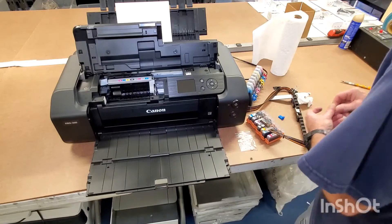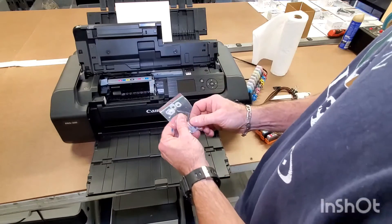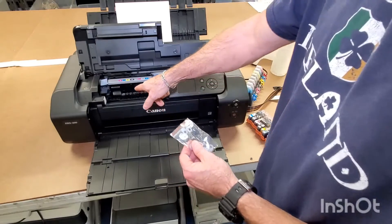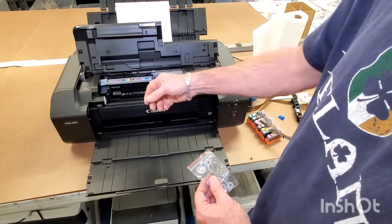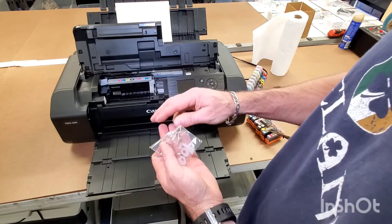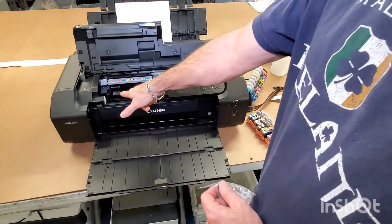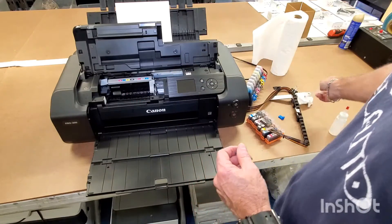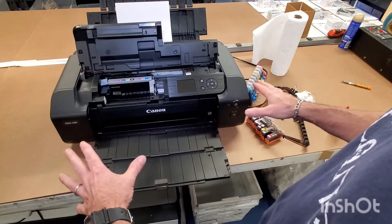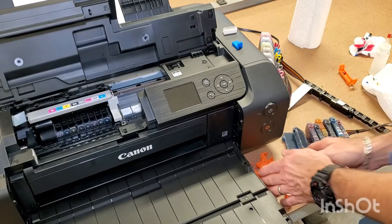After that's done, the next thing — we give you these little silicone gaskets. This is for the CIS and also for the printhead. If you notice, I've already put the set of them in there. With the original gaskets that come with the Canon printhead, sometimes they're a little bit shallow, depending on how they're manufactured. I've already installed mine, and that's just going to help create a good vacuum for the cartridge. After that's complete, you're pretty much ready for the installation.